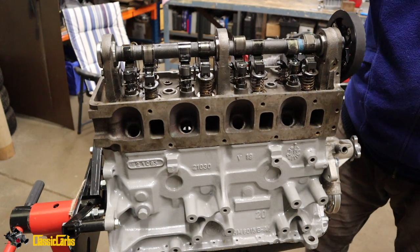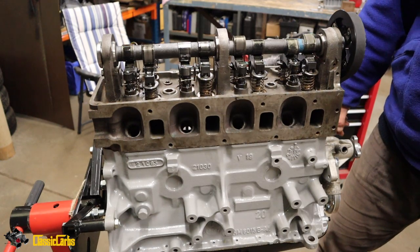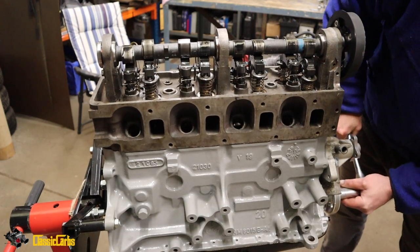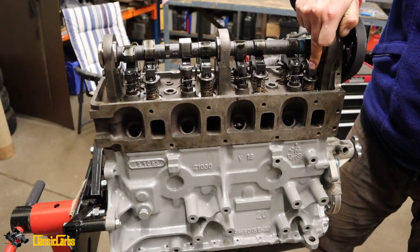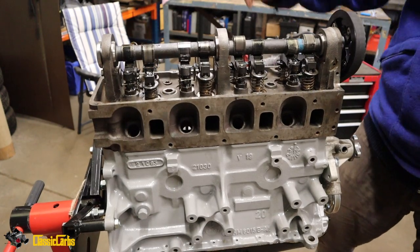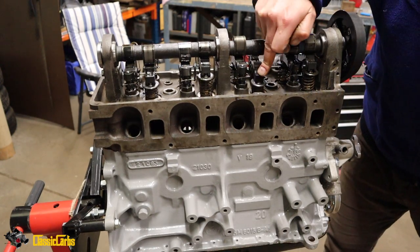So that's piston at the top for exhaust valve number 4. See, that's got more play in it for the same. Why is that happening now? Do you see what I mean? You can hear that. I'm going to carry on doing it. I'm going to go back to cylinder number 1, exhaust stroke, TDC. Okay, it's the same. Oh man, tedious, isn't it? It's got to be done now. That still has more play in it. Now that might be down to the clearance. Let's try it for another one.